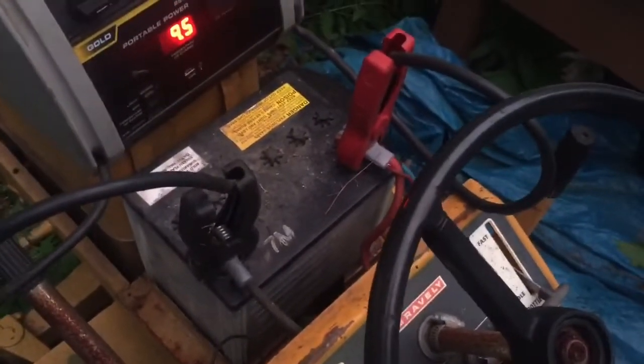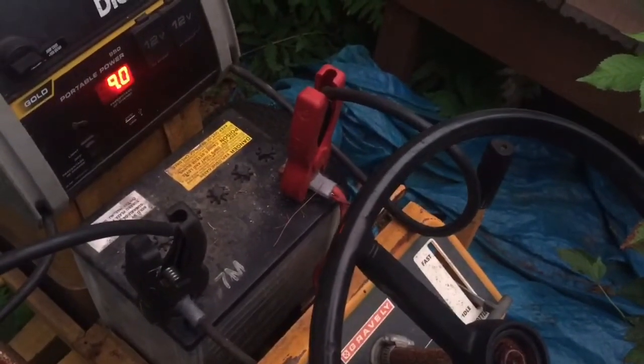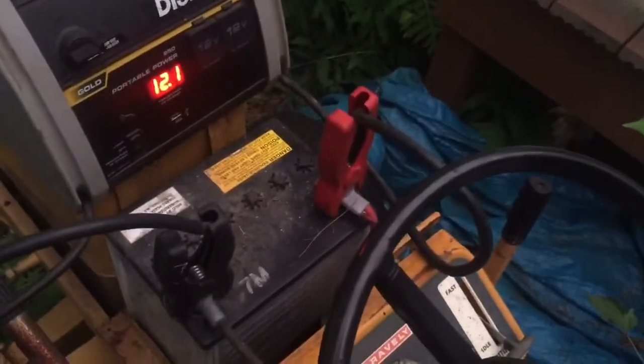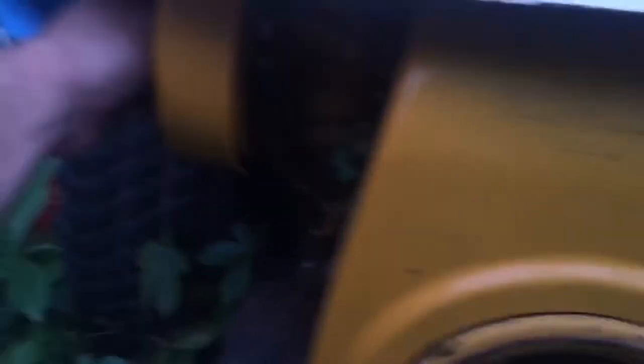Crank's good. It gets to a point where the motor has so much compression it can't turn over. What I was doing is coming back here and spinning the flywheel — the Bendix is engaged, there we go, it just came out. I think what I have to do is give it a squirt of carb cleaner in here because the fuel is probably all sucky in there.